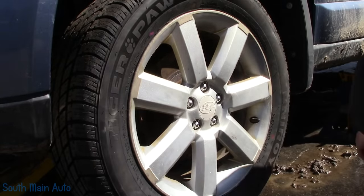It was easy. I did get all new studs for it without looking at it, because sometimes even just the rotor coming loose, you know, somebody loses a wheel and the rotor's been chucking around on there, it'll wall them up, but I don't see a single mark on these things. So I guess we can just clean up this hub face, get our brakes put back together while we're waiting.